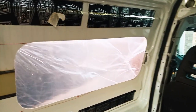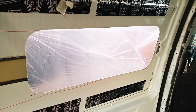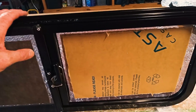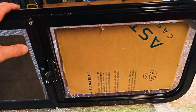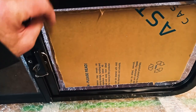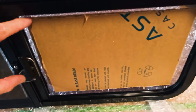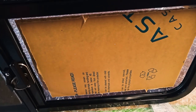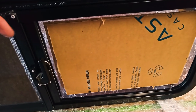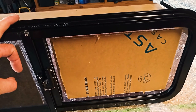The next thing is to install these windows. I'm going to start with the one in the sliding door. But first I need to come up with a way of securing the window in place while the glue goes off. These windows don't have a flange or anything like that that fixes them in place — you've basically just got to bond the window to the panel. They've got these grooves in here that the window runs in. My plan is to cut a piece of timber which I can slot into that groove and then another piece of timber that will bear across the frames, and then I can clamp those two pieces together to pull the window in. It'll probably make more sense as I go along — as long as it actually works.